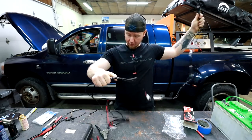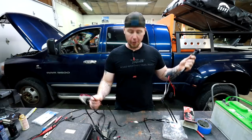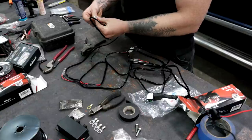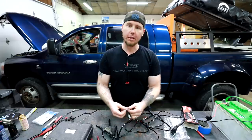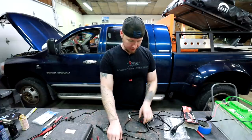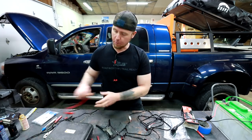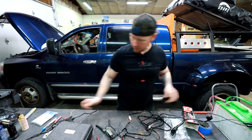It's pretty slick, relatively inexpensive, and you have everything you need to get started, then you can mod it for whatever your needs are. I'm setting this up to the battery just to make sure that when I turn on this switch, we can hear the relay click and we have power to these ends. Before I invest a bunch of time in installing this, I want to confirm that everything works. I hear the relay clicking, which is a good sign, and now I can use the power probe to test and make sure that we are actually getting power to where we're supposed to be — and perfect, it's all functioning.